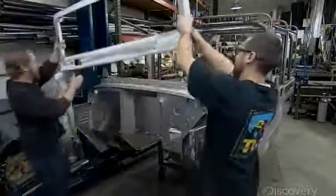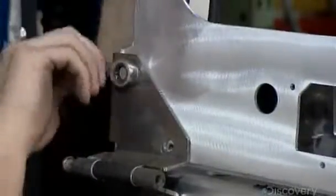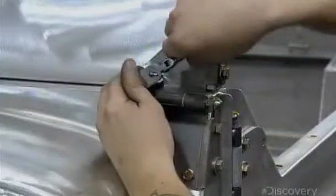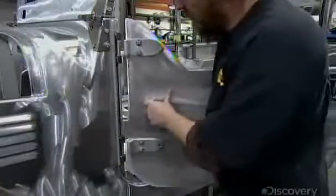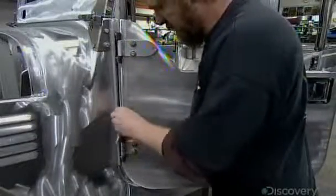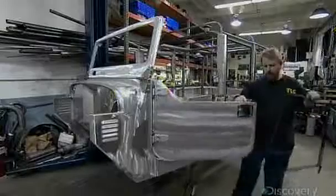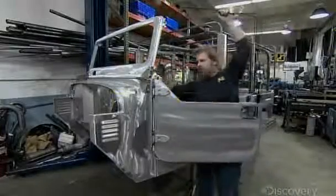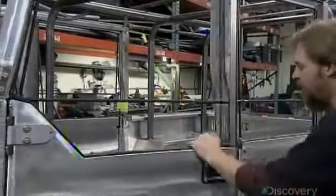This pre-assembly will ensure all the aluminum parts fit together flawlessly. After this, the SUV will be completely taken apart for painting and then put back together again. He hinges the doors to the body with thick steel pins that hold up to wear and make assembly easy. He attaches each window frame to the lower door panel and checks the fit, since any gaps could allow the wind to whistle into the vehicle. He confirms the parts align and that the door latch works.